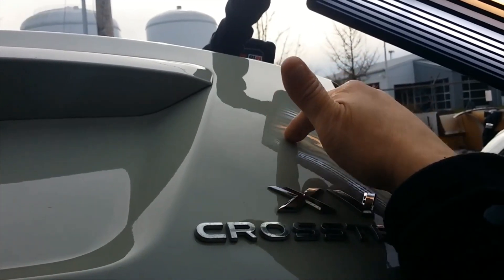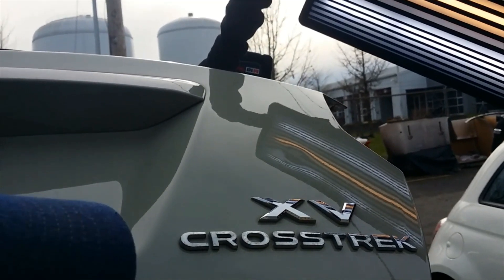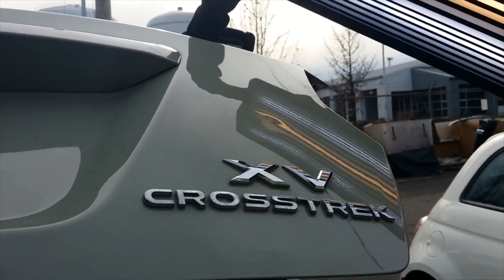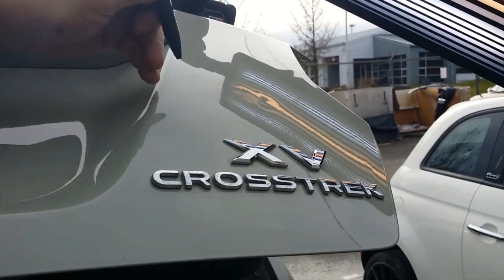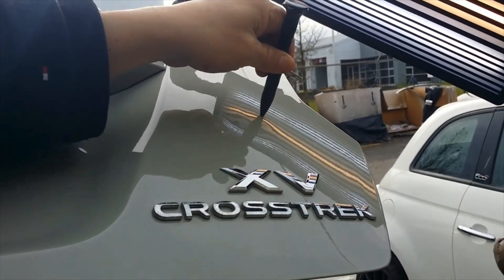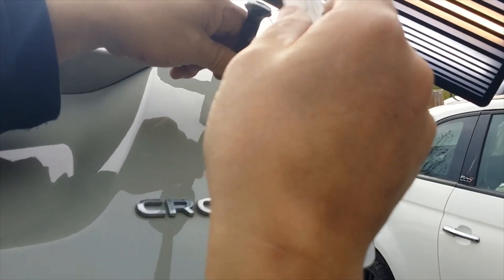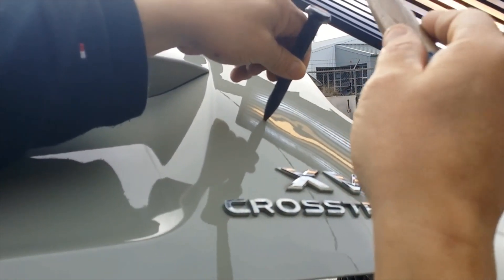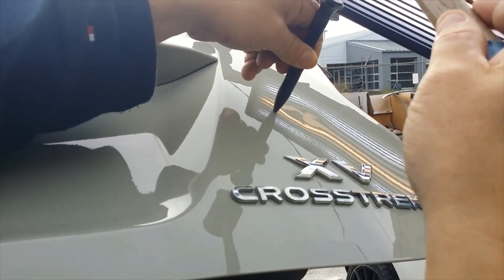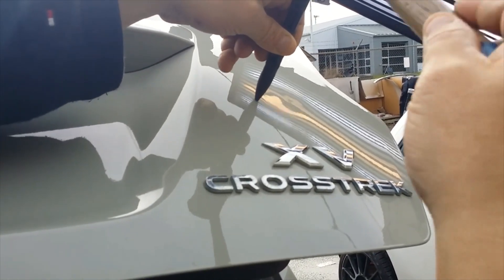I do see that I have this line and I'm kind of being impatient by not taking it out. I'm going to grab my hammer tapper and take out this line just nice and easy. Find the high spot — there's a highbrow there, highbrow there, and highbrow in here. I'm basically just dropping the hammer, not hitting it hard — finding those high ridges.